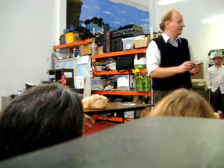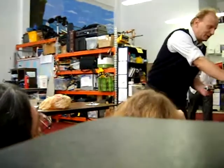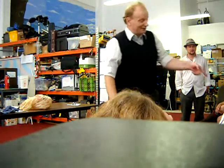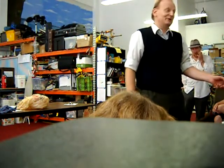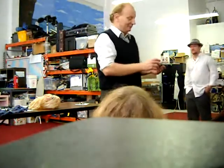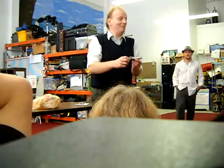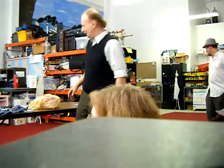And now here's one that doesn't get broken too often. Why is that? What is this? If that is a spindle to the bottom bracket, what is this? That's an encased bottom bracket. Those are the kind you just throw away and get a new one, right? Yeah, it's kind of recyclable, but you'll find these things hold up a little bit longer. So you're normally resurfacing those. What does this have inside it? Lots of seals, more bearings, and lubricant. Absolutely. So there you go. That's the average.